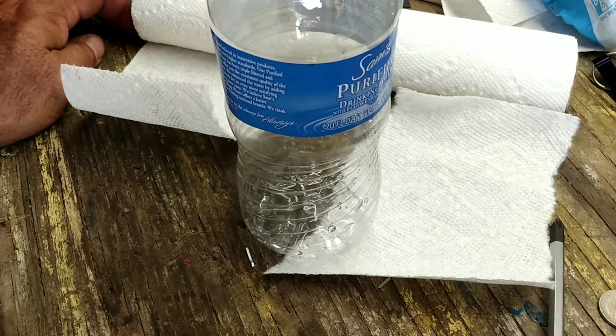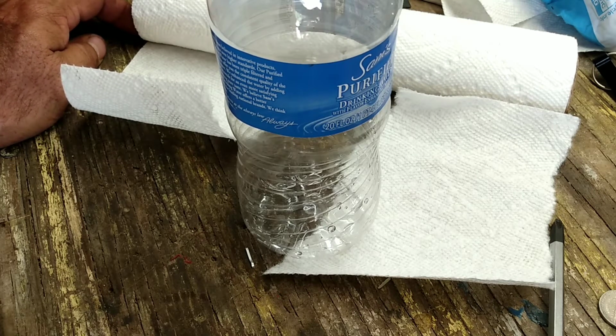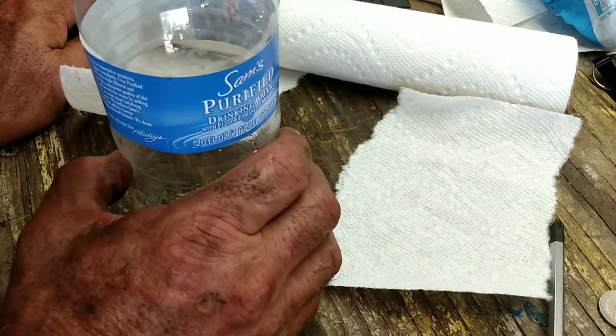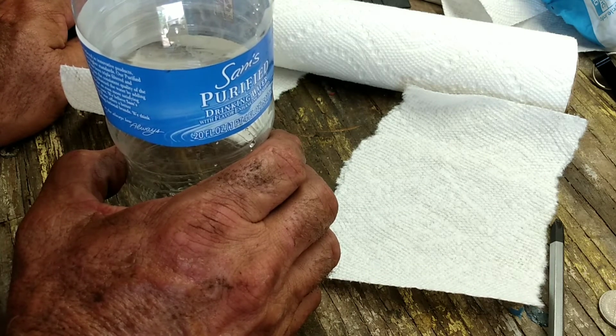Okay, so I'm still pulling on this thing, and it's not starting. I'm thinking, no, I haven't pulled the exhaust off yet, because I just don't think that's part of it. But if I got compression and I got fuel, or I think I got fuel, and I know that I have spark. I did the spark test, and the timing is correct. So I'm wondering if maybe there isn't water in the gas. I mean, that would explain it.